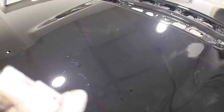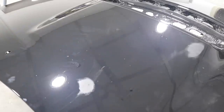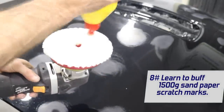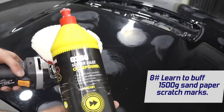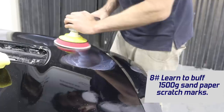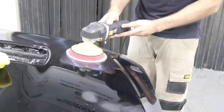The job is painted and I've left it for about two days, and as you can see I've got quite a bit of dust still in the job, so I'm going to start sanding that out. I'm using 1500 grit 3M disc on this three inch air sander — I'm basically just going to sand all the dust out and then start buffing those scratches out. Another tip: a lot of people think you need to go 1500, then 2000, then 3000, then 5000 grit. But if you're good with the buffing machine and you know your compounds and pads, you can buff out 1500 grit sandpaper and not see any scratch marks at all — saving quite a bit of time.